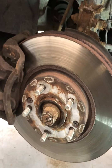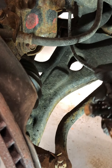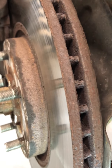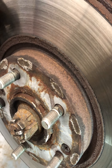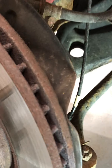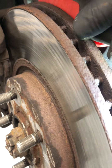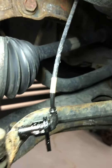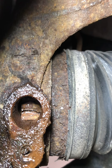I removed our left front wheel and the left front wheel speed sensor. I was thinking it might be seized because it's old — if it's seized you'd rather remove the driveshaft and inspect from there, then just replace with a new sensor. But I was able to remove the sensor. Now I'm trying to turn the left side, and as you can see there, there's a crack in between the tone ring.